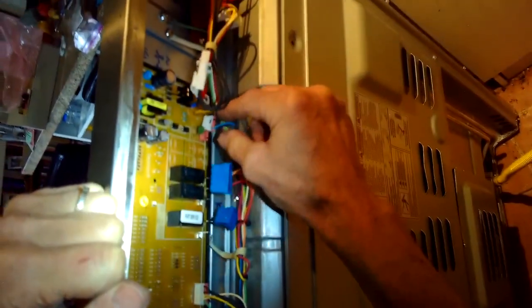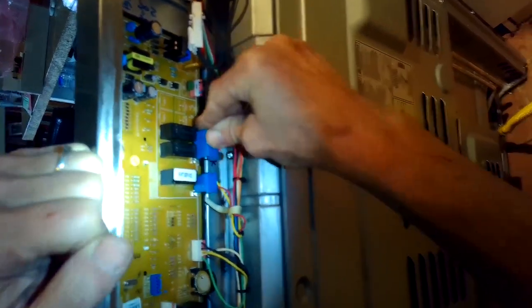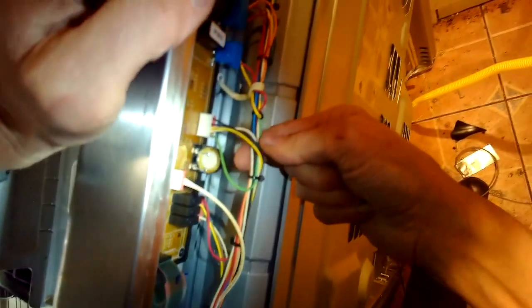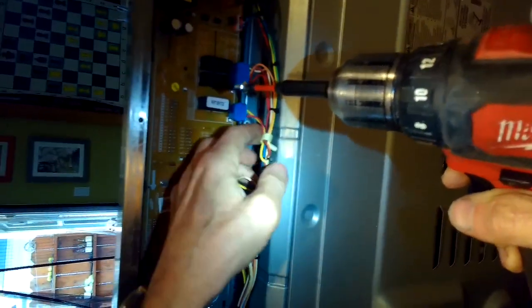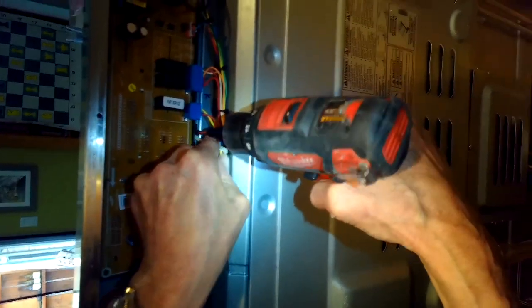We're putting these little modular connectors in, making sure they're fully seated. The blue ones here are for sending power to the broiler and to the bake — they're a little bigger and more robust, so make sure they're fully seated all the way in. Make sure all the connections are tight. This is also really similar for the LG oven — LG and Samsung are very similar parts and very similar appliances made in South Korea. There's one more screw here that's holding onto a wire tie keeping the wires bundled, so we put it through that first and then lock it into position.